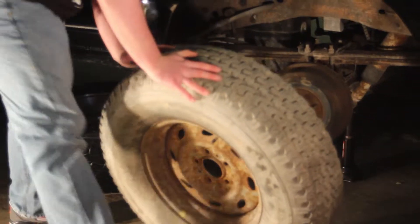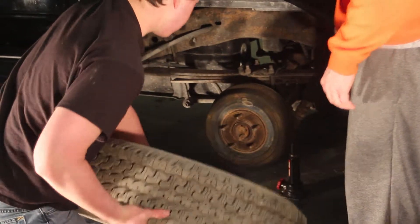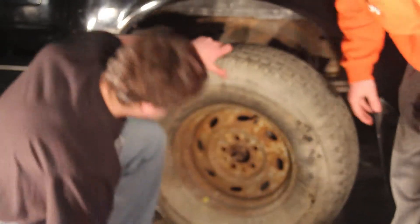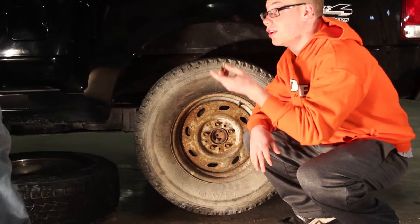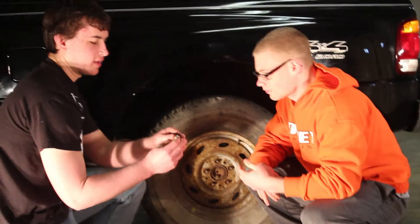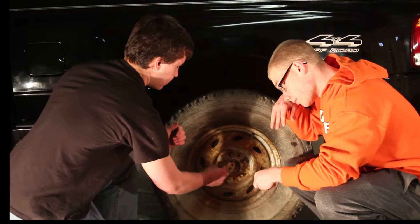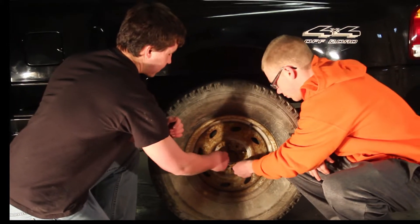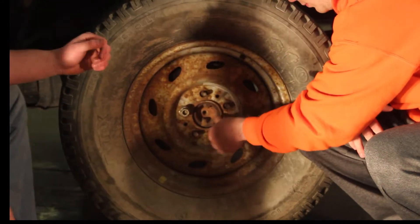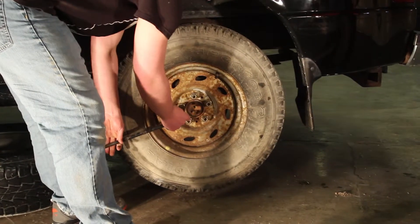Alright, next we're going to put the tire on. This might take a little bit of time to figure everything out, because you want to get your holes lined up. So do we just put the lug nuts back on? Make sure to put them back on in that star pattern. Don't put them on if they're going to cross-thread — if you don't, the tire will vibrate. You want to be sure to put them on in that star pattern, getting them hand tight on the wheel. Tighten them down a little — but not really tight. Do that once you put it back on the ground.